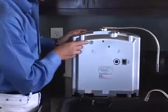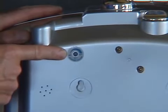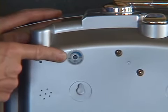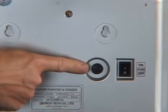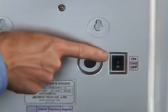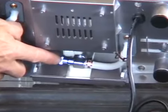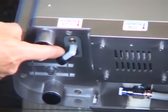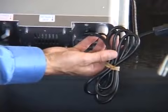On the back of the machine at the top is a great feature — this is the speaker volume control. You can use a small Phillips screwdriver to adjust the speaker volume up, down, or turn it completely off if you don't want any speaker volume at all. These are keyhole slots that you can use for mounting your Athena on the wall. This is where you would replace the fuse if you ever need to. And this is the on/off switch. Moving to the bottom of the machine, we have the tap water inlet port where you'll connect the tap water hose, and here is the acidic water outlet port where you'll connect the hose that drains the acid water out of the Athena. And last, we have the power cord and plug.